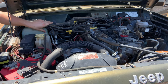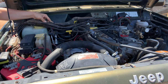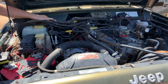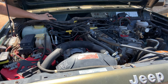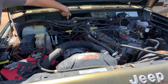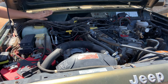I got enough cut to get it out of the way. There's a bracket there — I think that's for your vacuum lines. It's possibly for your EVAP canister — not entirely sure — but you do have to unbolt that bracket. There are two holes on the piece of metal that goes over the hole you cut that line up perfectly to remount your vacuum setup, so you shouldn't have to make any new holes on this side. You will have to drill and put in two screws on the other side.